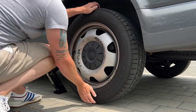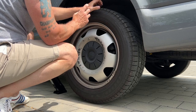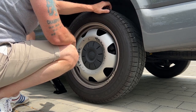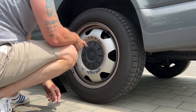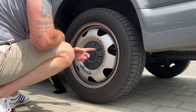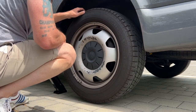That is solid, really solid. Give it a spin and see if we can hear anything like metal balls clashing together — that would obviously indicate that the bearings have gone as well. I can hear some noise, maybe you can pick that up on the mic, but that's just the brake disc against the brake pads, which is quite normal.